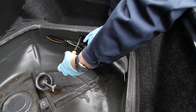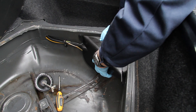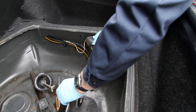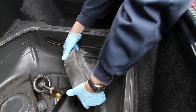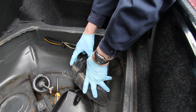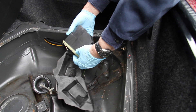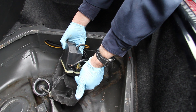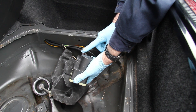To gain access to the pump, you'll have to remove the spare tire and then the bracket which holds this rubber housing up tight against the spare tire well. Then you can roll it over upside down and open it up — this will expose the pump. You can see it has both electrical connections and one vacuum connection.